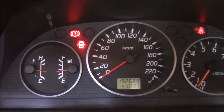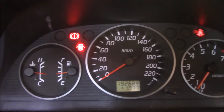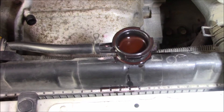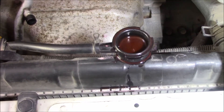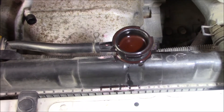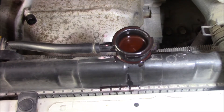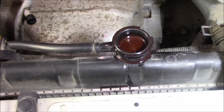For the next steps, we're going to need more equipment, and we need the engine up to operating temperature. You may also experience some bubbles in the coolant coming out through the radiator. It's not too bad in this case, but generally if combustion gases are going into the cooling system, you'll see a lot of bubbles at idle or even under acceleration.